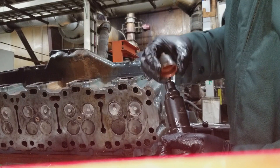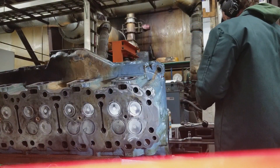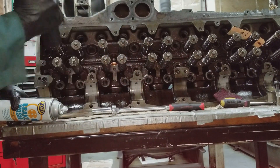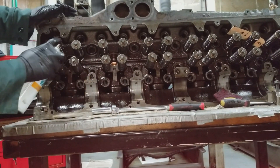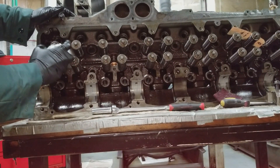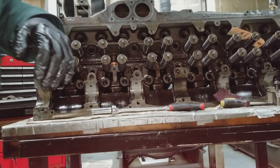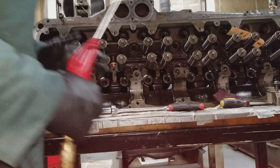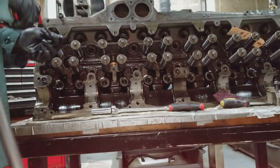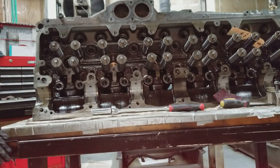There's the old cup — you saw the little part get cut off. You just tap on it; you don't have to wail on it. Now you're going to clean out the injector cup seat really well. You don't want any crud in there interfering with the o-ring. I'm using compressed air, brake cleaner, and a rag.